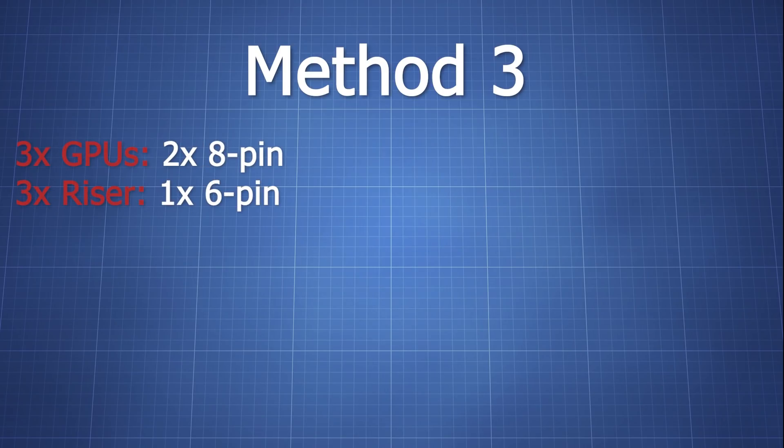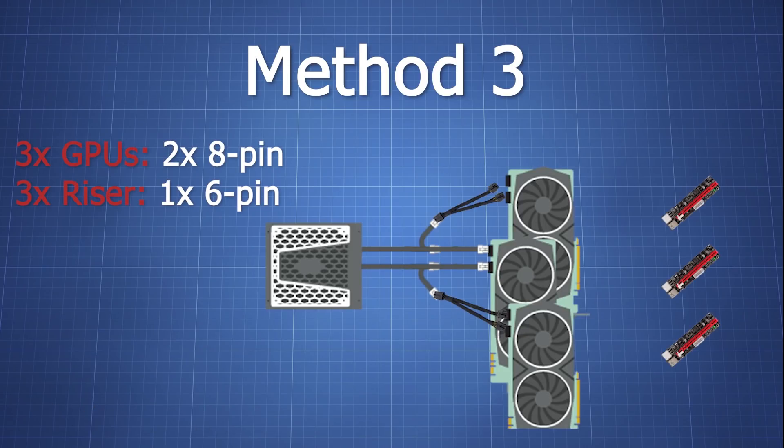For method 3, it's also for dual 8 pin cards when you're running short on cables. This will work only on GPUs that use 150 watts or less for mining out of the wall. You will be using 2 cables of dual 8 pins and 2 splitters to power 3 GPUs. You will have a total of 6 8 pins using the splitters, and then from there you can do 1.5 GPUs per PCIe cable, spreading the load of 3 GPUs on 2 different cables. As for the risers, you will have to use Molex cables — 2 risers per Molex — or you can add 2 more splitters to power 2 risers and then 1 riser with Molex.